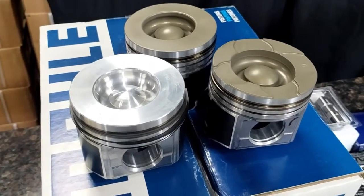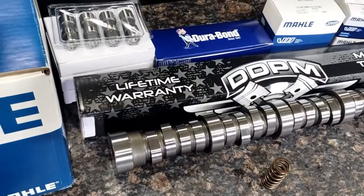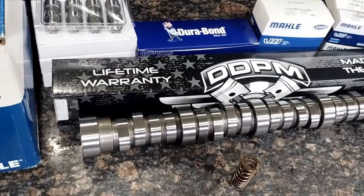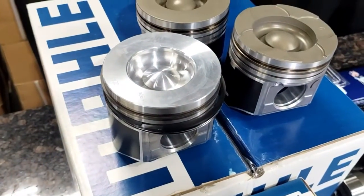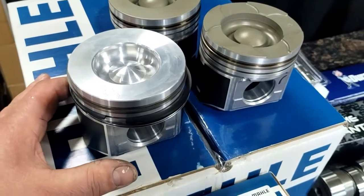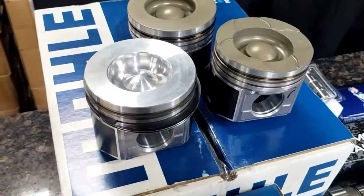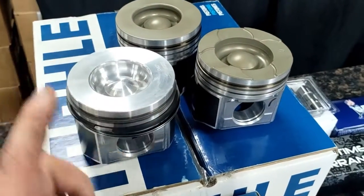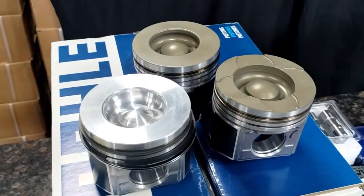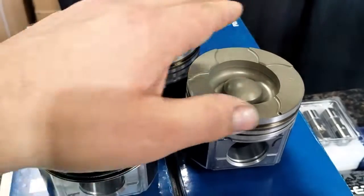If you order a Stage 2 kit, you can do it without coating. With the Stage 2 stuff, the camshaft does have higher lift, so you want to make sure your valve recessions are above 23 thousandths on the intake and exhaust. Valve recessions refers to how deep the actual valve is in the cylinder head. Also, your piston protrusion — you don't want to see more than 34 thousandths. If your block's been decked, that's why we have our mil option, the reduced compression option. If your block's been decked at all, we always suggest doing a 10 mil or a 20 mil. Make sure you ask your machine shop how much they took off the block — that's a crucial number. You don't want to be over 34 thousandths at top dead center. These pistons do stick out of the hole at top dead center. Another option is to put the fly cuts in them. A lot of guys with the Stage 2 stuff do put the fly cuts in them — just for an extra fail safe. You don't need to, but it's always a good fail safe.